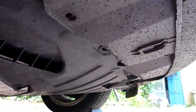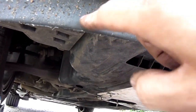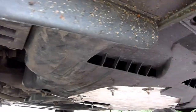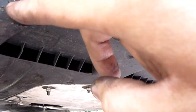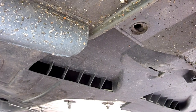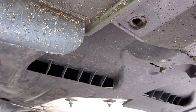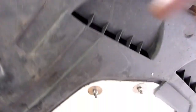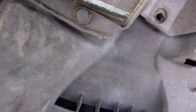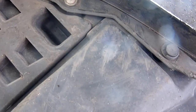In this video I want to do the tracking on some of these cars. The mud flaps always scrape underneath when you're approaching a raised speed bump, so I need to remove them because they get in the way of the laser tracking device. They've often got plastic lugs — I'll point there — and this one's got a screw as well: plastic lug, plastic lug, and screw, and a plastic lug. That should pop straight off.